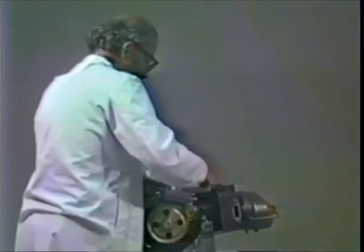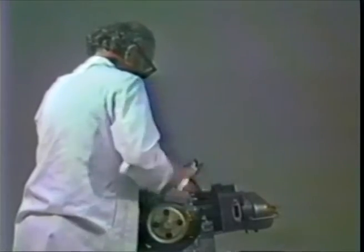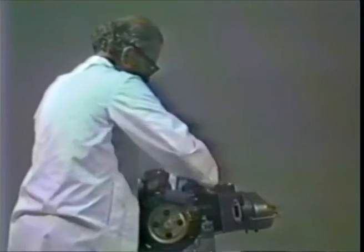Don't lean on these too much when you're torquing them down. You can torque them to 15 to 18 foot-pounds. Of course, you have to use a calibrated arm on the right front one, simply because you can't get a torque wrench in there to torque them down. This isn't very critical anyhow. The generator stand just has to be tight, not held in by King Kong-like torque. So we'll tighten this down now.